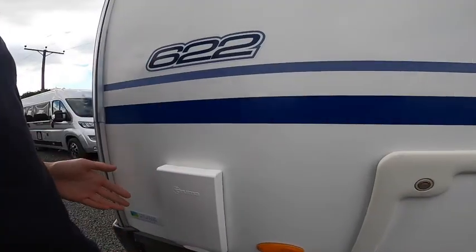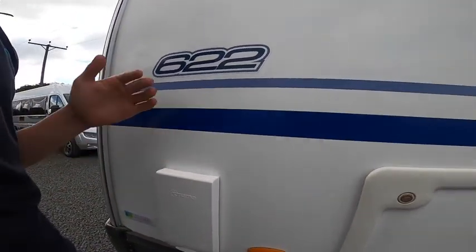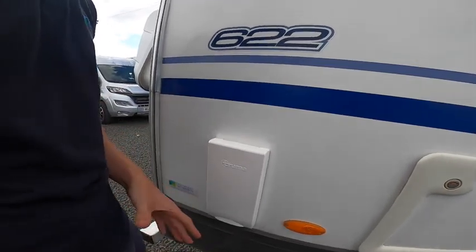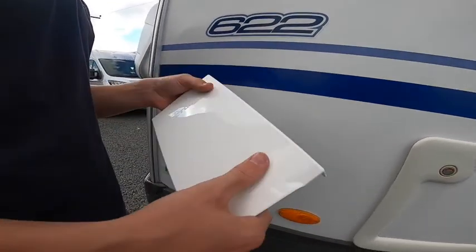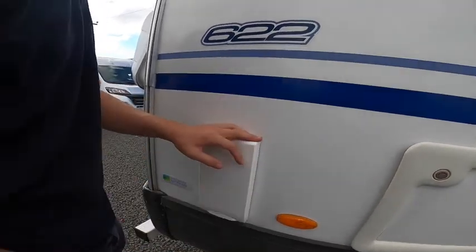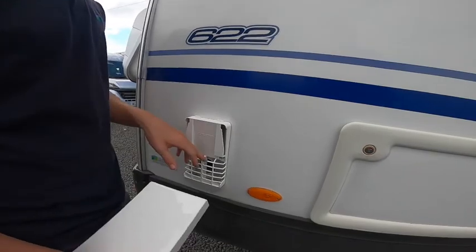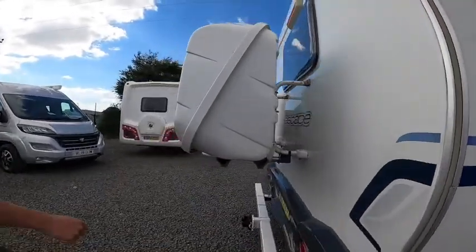This gives the location of your boiler on the vehicle — it's in the back corner of your lounge. This cover needs to come off when heating the water on gas because it won't allow the fumes out the flue, it'll clog the exhaust, and it won't heat the water as it's a fail-safe system. To take the cover off: hand on the top, thumb in the middle, peel it off. Pop it in the gas locker or the driver's door pocket, and before you travel just pop it back on so you don't get it dirty from road dirt.